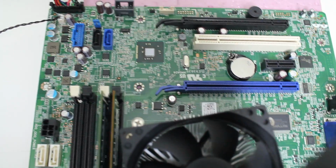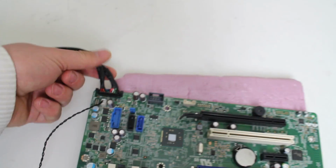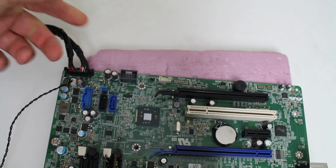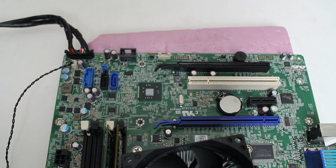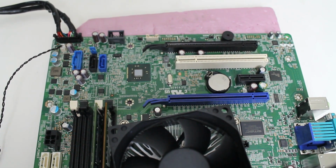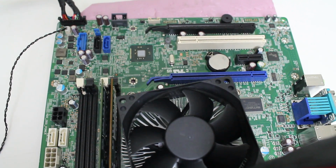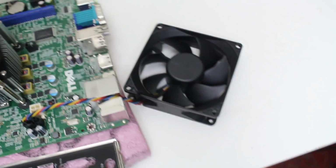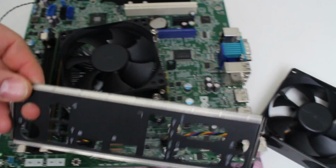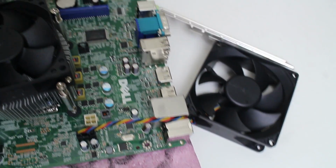And this is the other thing that you need to keep. This is the front panel that usually will come with this. I just took out the whole thing for you, but really all you need is this to be plugged in, and you could just cut the wire here and maybe tape it up with some electrical tape and hide it. Otherwise, upon starting up the computer, you will get an error and the fans will blast at maximum speed, and it'll be too loud and really annoying. At that point, it's just not a clean build at all. And then of course, you have the I/O shield, which is very nice quality, all black. It will go perfectly with your case.